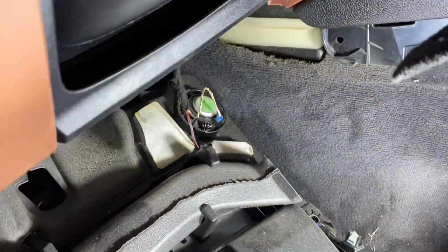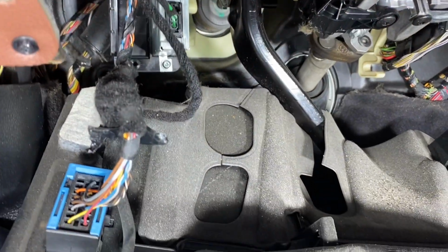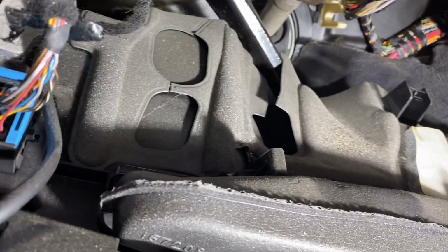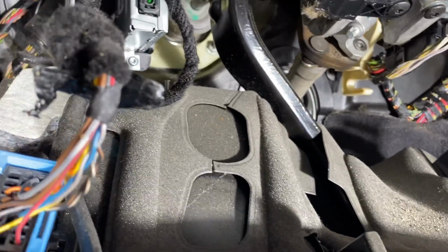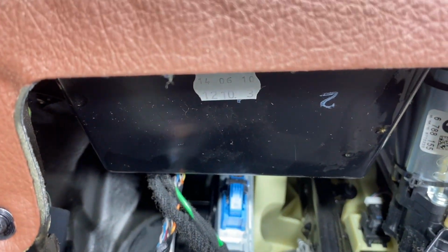So that's all done. Now typically what you would do is you would just push that wire through the grommet on the other side that we discussed. I'm doing mine a little differently just because of the way this is a used harness. I'm not sure if you can tell, I don't think you can see it up there, but what I've done is I've just taken a little screwdriver that I had and pushed it through, and I can actually see the tip of it. So I'm just going to tape my wire to that and then pull it back through.